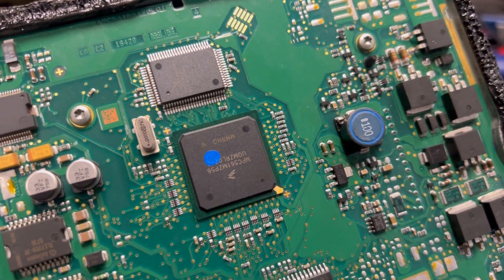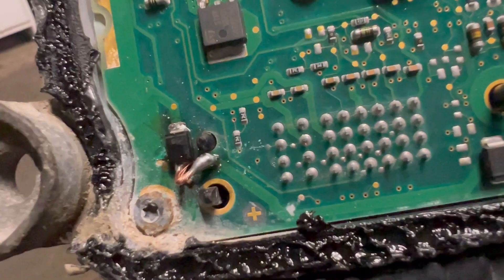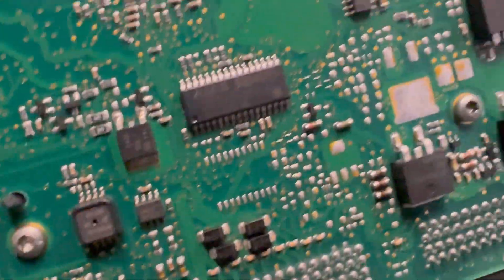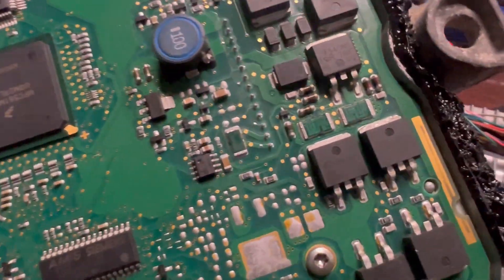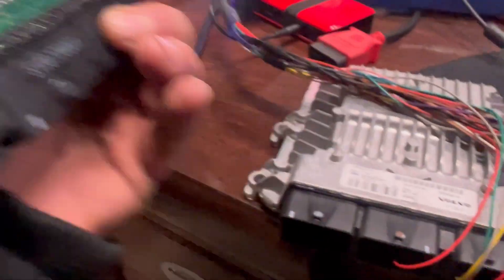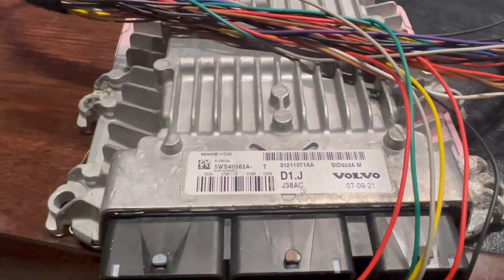These MPC components can probably be fixed or replaced — like in this case, I just did it to be able to read the ECU. I knocked it off from another location on the board. All the other components seem to be fine. But the seal is the real problem — you can see how water gets through. Hopefully this will work longer. Anyway, we now have a full dump from the car, so if this one goes bad, we can replace it again.